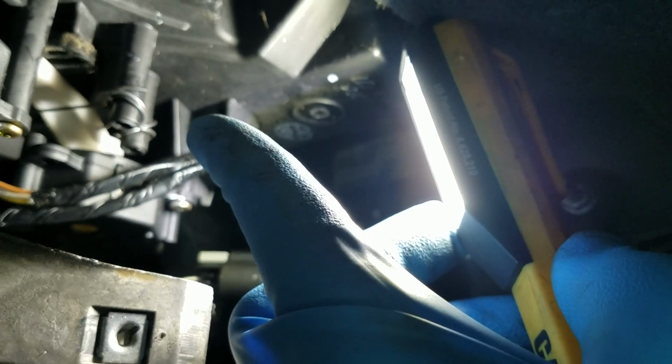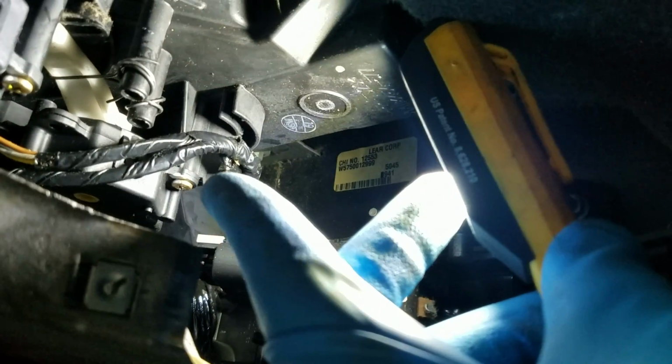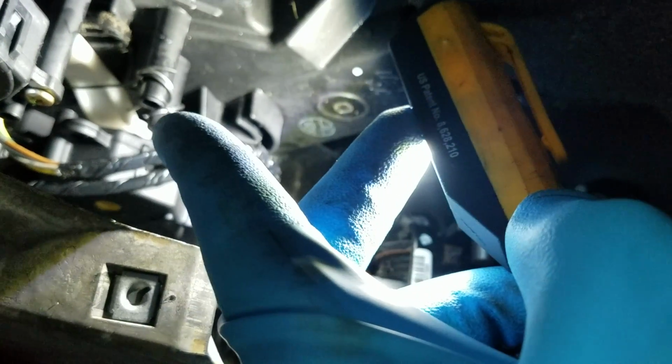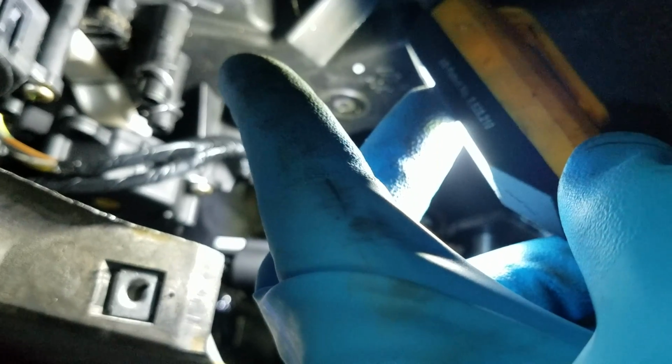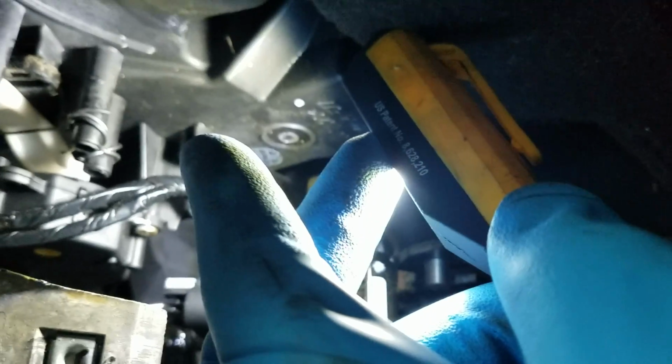That white piece that I put my wire on was stuck on top, which means it was stuck on heat. I ended up playing with the cold and hot switch, and I figured that this motor was vibrating. Nothing was moving, it was just vibrating. So I used my screwdriver and pulled that white piece from up to down here. It looked like it's sideways, but it's still more below compared to where it was when I got it.